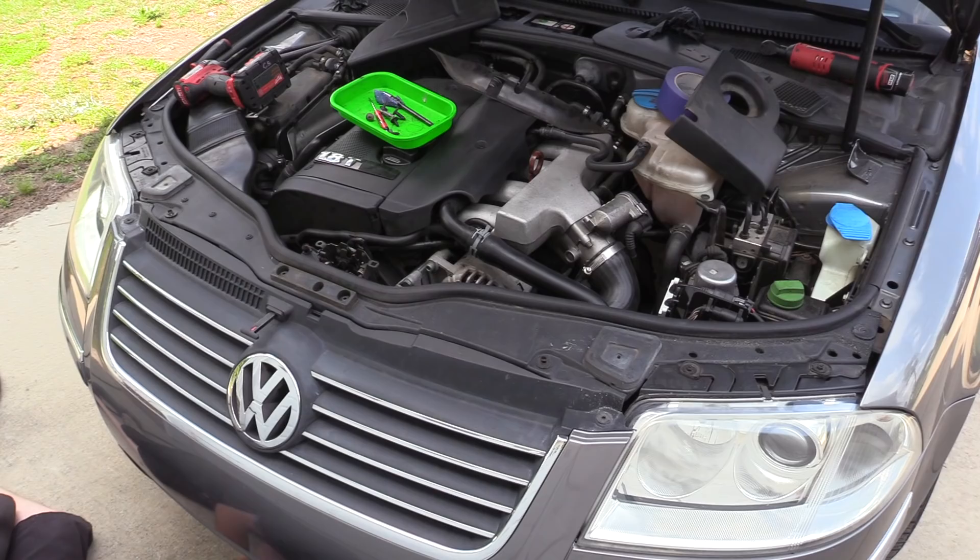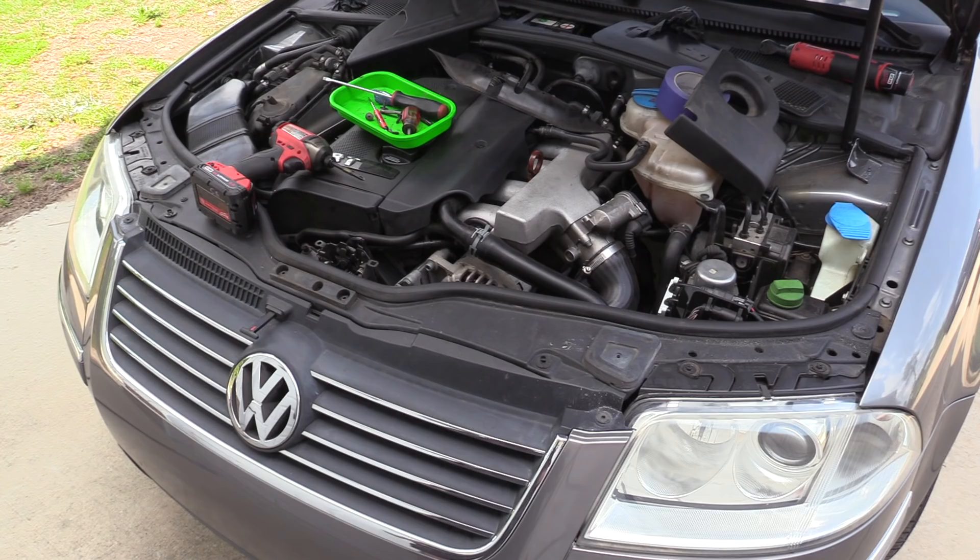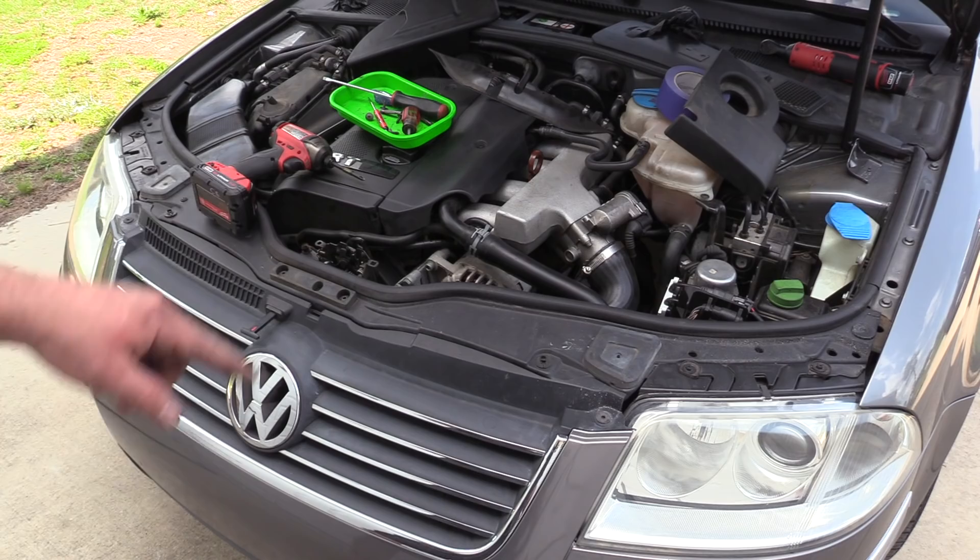Of course, don't forget to put the quarter turns back in down at the bottom. After that, all that's left is to make sure all the gaps look good, the lights still work, and double check your hood pull — it's better to have it broken with the hood up than down. Put the last couple of covers on and we are all done. You have successfully removed and installed a bumper cover on an 05 Passat — very similar on the Audi side. This covers from 98 to 05 Passat, and most other Volkswagens are actually really similar, so you can use this as a guide for your Volkswagen bumper.